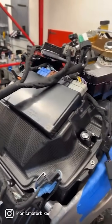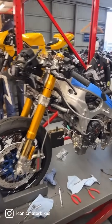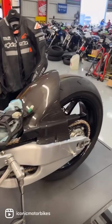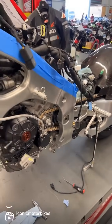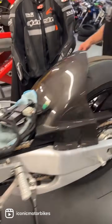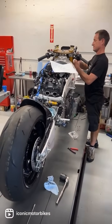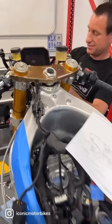Especially when we ride it — there you go, you can ride it. Airbox lid's on, electronics put on, this goes in the tail — back here somewhere. It's getting there. This is video number five — our final one for the day because Ollie works the early shift. He's got the rear wheel on from this morning, motor's in place, spacers in place, front sprocket on. The owner called and said: when you're putting the race kit on, you have to choose — street or track. He has zero intentions of riding this on the street, so it will be his track bike. RC 213 V as a track bike — pretty cool.